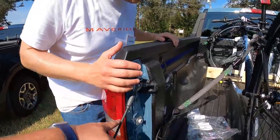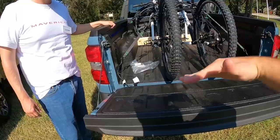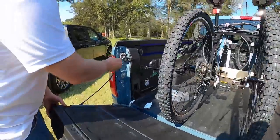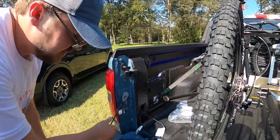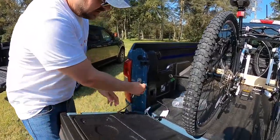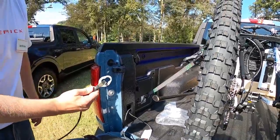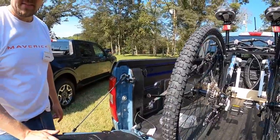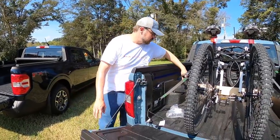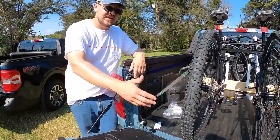In this one, you've changed the bed height too — you've moved the hook up higher. There are two spots for that. So this kind of extends the short bed and gives you a nice spot, keeping stuff in the bed at an angle. So how does that work — does it just pull out? Yeah. This is what we call our multi-position tailgate, standard on all trucks. When you get your truck, the tailgate will be flush as you'd expect. What you can do is lift the tailgate, undo the engagement using a simple tab, pop it off the main pivot, and move the cable end up to the latch striker. The tailgate is then held open at the intermediate position — a simple and elegant solution. The tip of this is perfectly aligned with the top of the wheel wells, which enables you to carry four-foot by eight-foot sheet goods or, in a case like this, provides that extra length for bike tires.